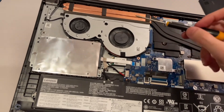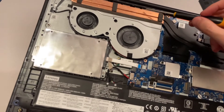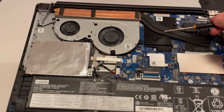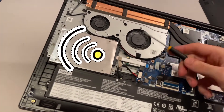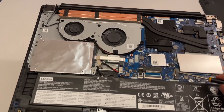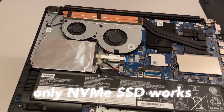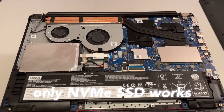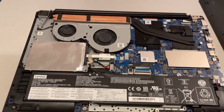There's a bigger and a smaller cooler, which ensure a big airflow across the heat elements to cool the GPU and CPU. Here we have the Wi-Fi card underneath the SATA drive cable. There is also another slot free here where you can install an SSD. From my experience, SATA SSDs did not work — you need an NVMe SSD, something like this Kingston one.